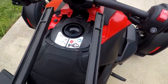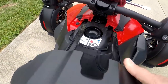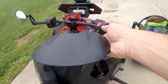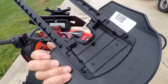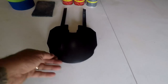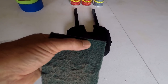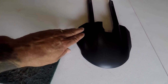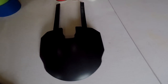I popped out these two rivets right here and then this lid just picks up a little bit — slides right out. There are the tabs. Now I'll tape it off. I'll show you that — I've got to clean it, sand it a little bit, just rough it up. I'll use the green Scotch-Brite; it's fairly light course-wise. Just come to the edge here — you don't want to come down on the black area, so just scuff right up to the edge.